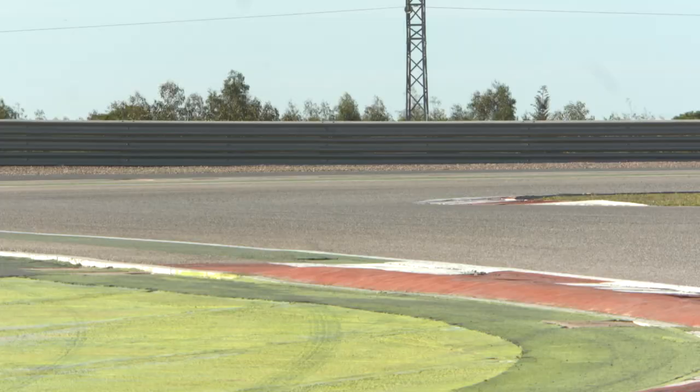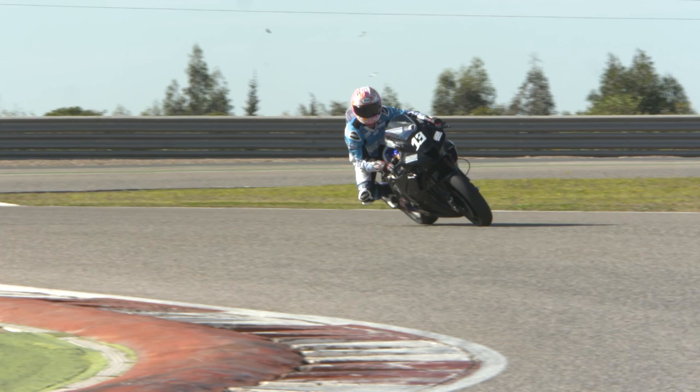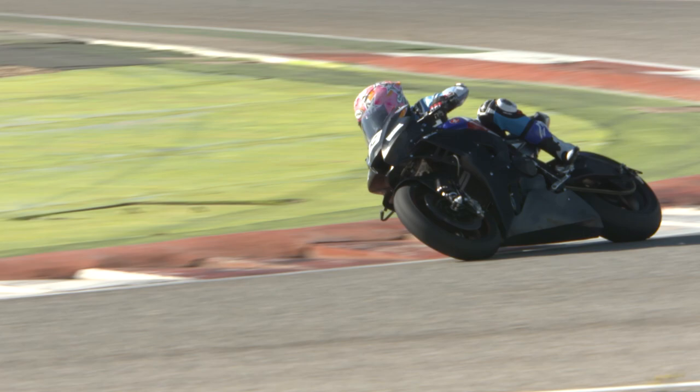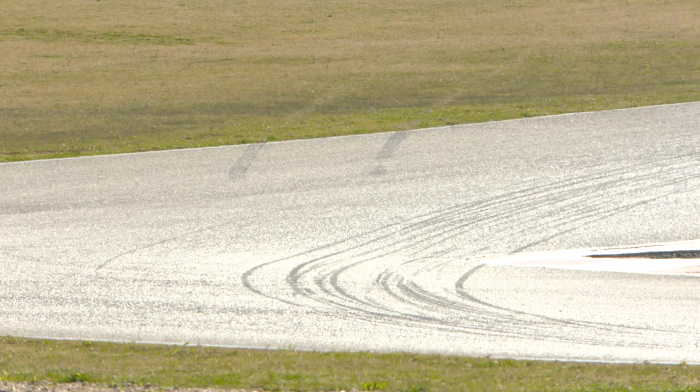For two sessions we spent doing that. I feel like we got it somewhere where I was like, yeah, it's not too much or too little. Then on the next session we introduced some traction, and this highlighted something straight away - which is why we do it in this order. When we introduced some traction, that made the wheelie work worse, because as I was coming out of the corner before, the bike was spinning and getting some momentum and still going. But once we introduced some traction, that was cutting the bike off, making it slower. So when I actually got the bike more upright, the bike was wheeling more with the same wheelie setting. Over some of the bumpier sections it was upsetting the bike more.